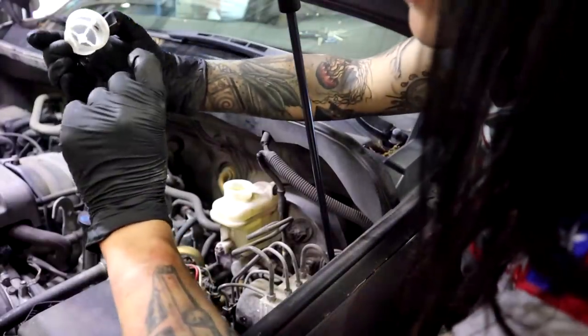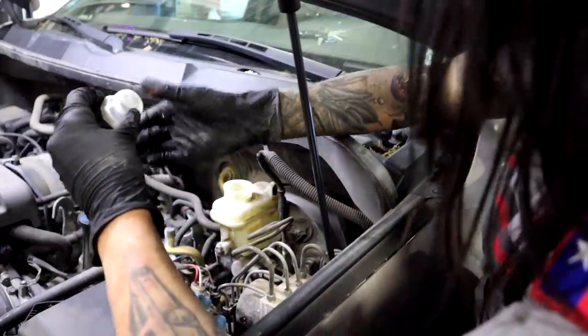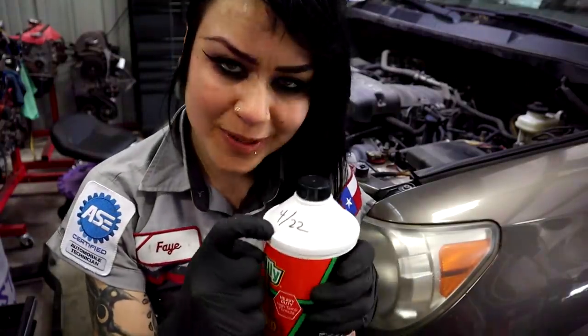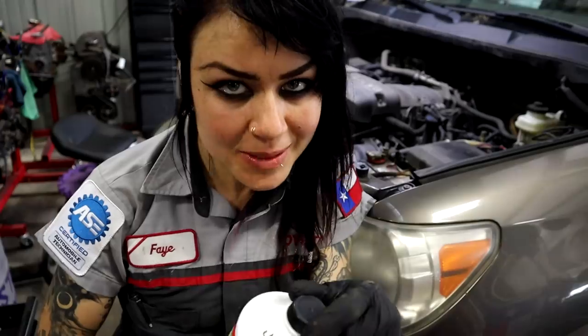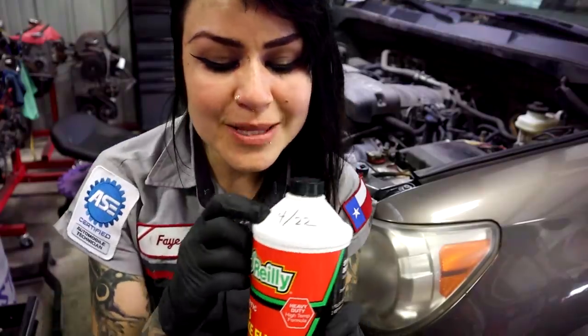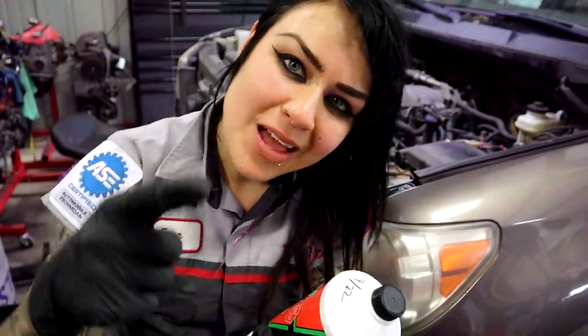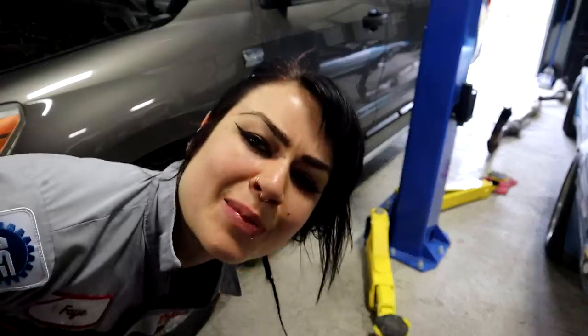Now that I've got the screen off, I'm actually gonna clean the screen, then come back and put it on, then put the cap on. As soon as I open the bottle, I put a date on it for the date that I opened it. This is one of those fluids that as soon as you break the seal, it's only good for so long because it does absorb moisture from the atmosphere. I put the date so that I know if it's like six months or nine months old, I'll test it with my brake fluid moisture tester. But I'm gonna cover brake fluid flushing in another video — this is just about replacing front brakes, so carry on.